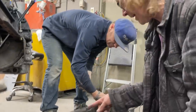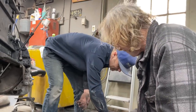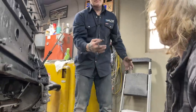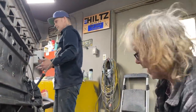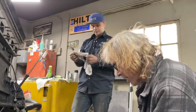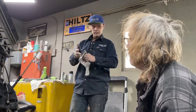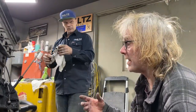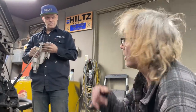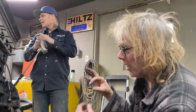But there really shouldn't be sludge down here because the filter should have picked up all dirt, all residue. Yeah, that's sludge. That's like the sludge of 1,000 miles or 10,000 miles. The filter's supposed to pick up all dirt. There should be nothing in the oil pan for this thing running for 1 minute. The filter should get it. So I'd say he's got the wrong filter or no filter, and that's why there's dirt here, because it's not being filtered. He must have the wrong filter in it, or it's too short and it's not hitting the rubber.